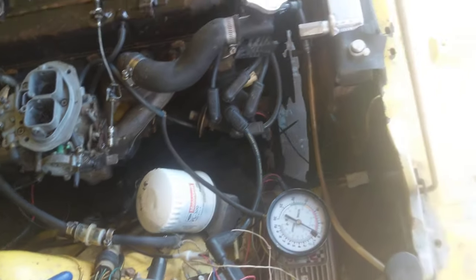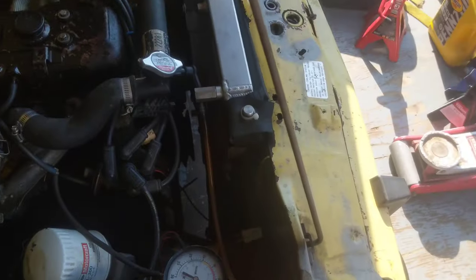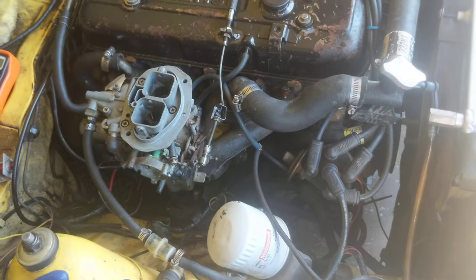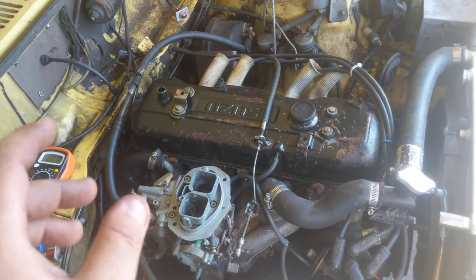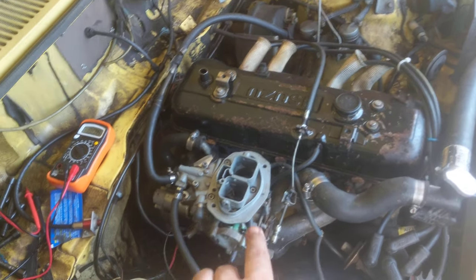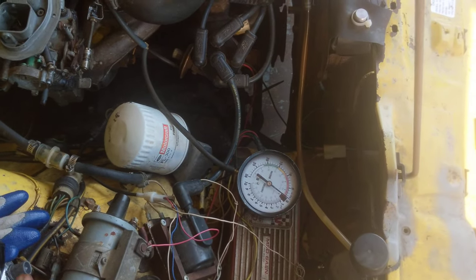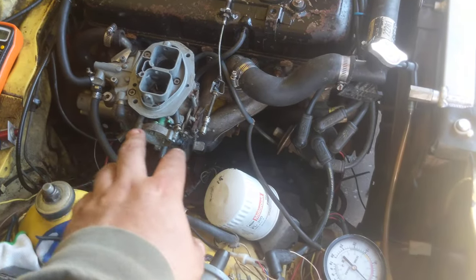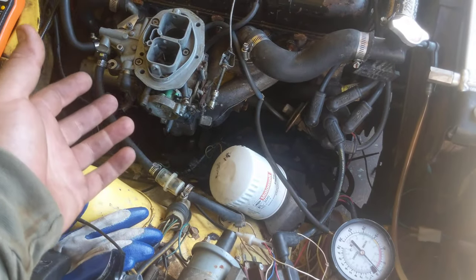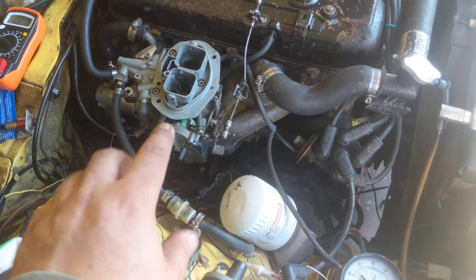This actually sounds about right. My Winnebago RV does the same thing, and my Challenger will probably be the same if I plug it in — depends on the camshaft and some other factors, but in most cases it's 21. So when you start revving up, if the mixture changes dramatically as you rev up slowly, your vacuum will do crazy things. If it's too lean, like it was a while back, it would drop all the way to 15 before the main jet takes over, and then drop back down to 21. So I had the stumbling in the transition circuit.